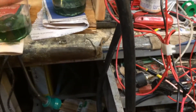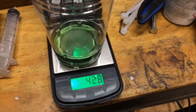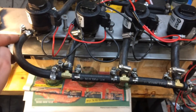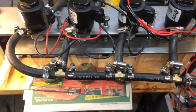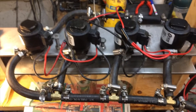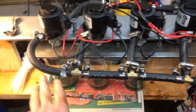This one is a little bit rich — maybe this injector is flowing a little more than the others. I'm not sure if it has something to do with my hookup here; this one is fed more directly while the others are fed with T-pieces. The other connections are actually pressed aside. We'll see if there's a tendency and whether we'll swap this one with another one.